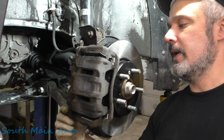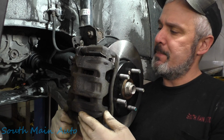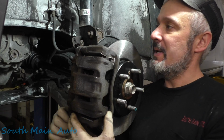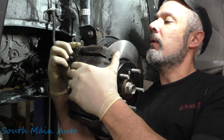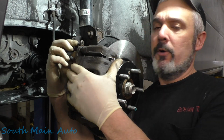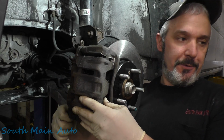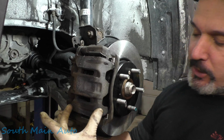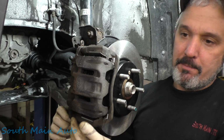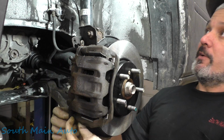You might not have been able to see anything right there at that moment. But when you're doing it and you're trying to get that clip on and them pads hit the floor like the 13th time, A, have somebody help you, or B, throw the clip away. Or C, I guess just do it like we did it. The other thing you can do too is get a pair of C-clamp vice grips, clamp them on your pads way down here at the bottom, put your clips on, start to bring your caliper around. And as soon as your caliper is on a little bit of it, it ain't going nowhere.